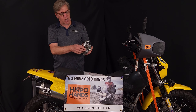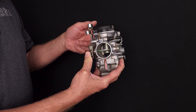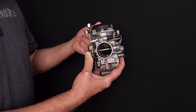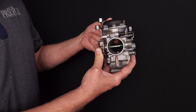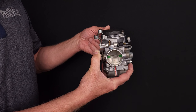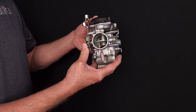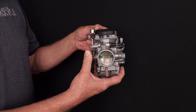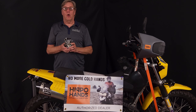When your cable is adjusted and you open up the throttle, it opens a butterfly valve. That starts the fuel flow a little bit. As the fuel flow increases, the vacuum increases, and the slide — which is vacuum-operated — goes up. The vacuum pulls the slide up, and then you get the power you initially requested. It takes a moment or two. And when you chop the throttle, it takes a moment for that slide to go back down. They do this for numerous reasons, and it's what's equipped on all the bikes.